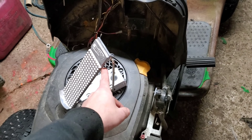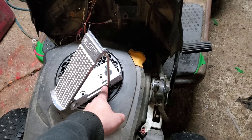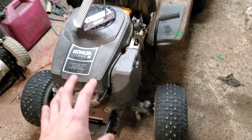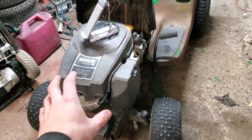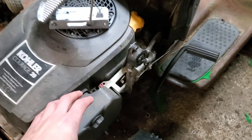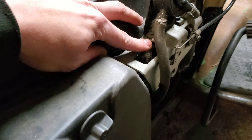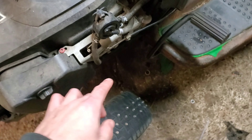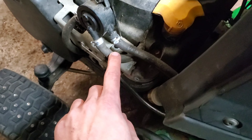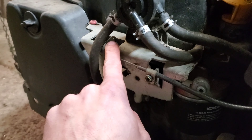It's nice, it's simple, it's easily adjustable, and if it moves too far you simply make something as a bump stop here, or you put a bolt in right here so that this can't move any further — nice and simple. This Kohler Courage really should be very easy to do this installation. The reason why it should be easy is because it has an independent choke lever which is right here.